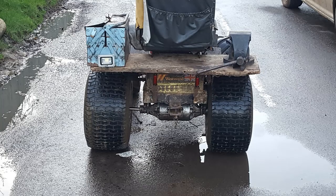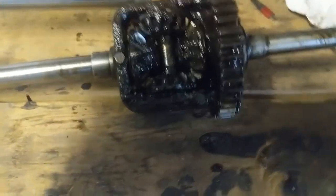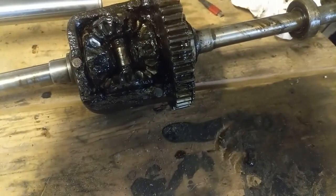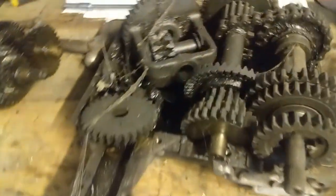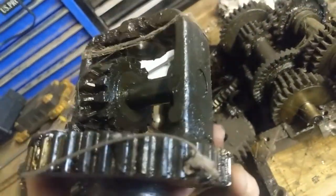This is the replacement axle. I tried to get the old wheels off and broke the circlips off, so I ended up having to weld these gears into place - which is fine, other than when you need to take them out to make something new out of it like I'm trying to do now. So in the old box, which is covered in cobwebs, is hopefully the piece I require. All I do is bore that out to an inch and then weld it solid to the shaft, and that will be a good little box.